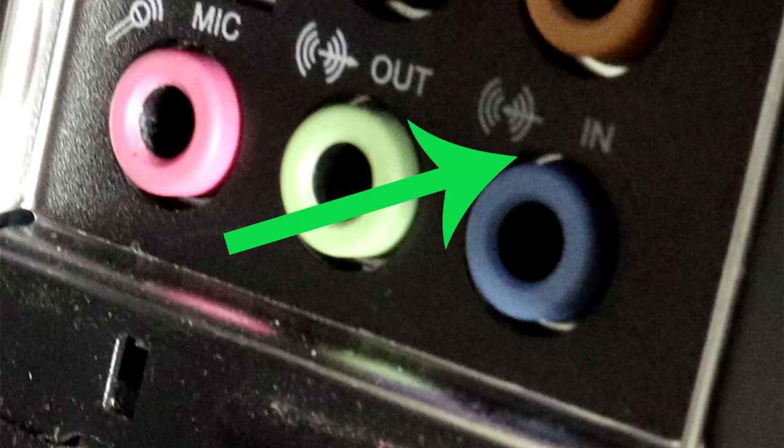All you need is a working cassette player and an audio cable with both ends at 3.5mm — or maybe if your tape deck runs 2 RCA then one end matches your tape deck and the other end is a single 3.5mm jack, because most line-in ports on computer sound cards look like this. If you know what I'm talking about, great. If you're interested in how I used to do it back in the late 90s and early 2000s, stay on. We've already accomplished our agenda — testing these MP3 capture devices for cassettes — and they both work.